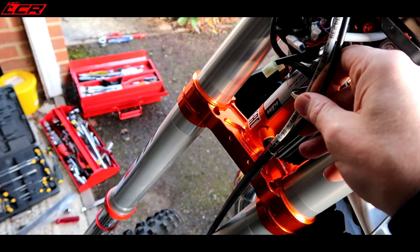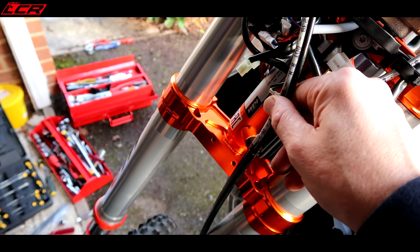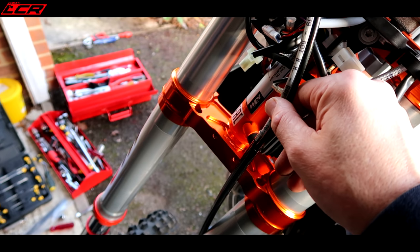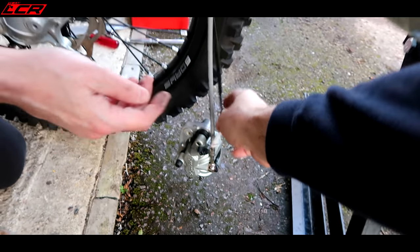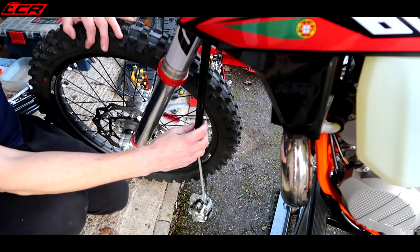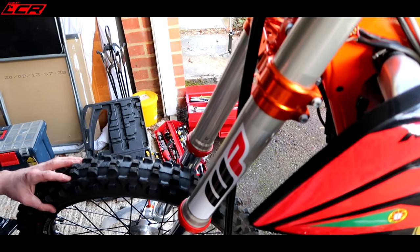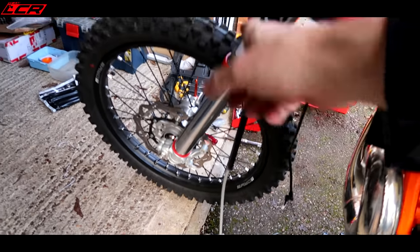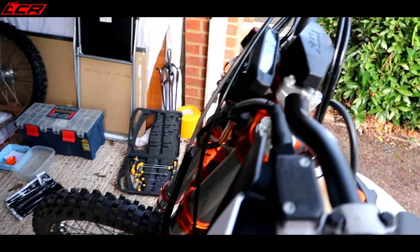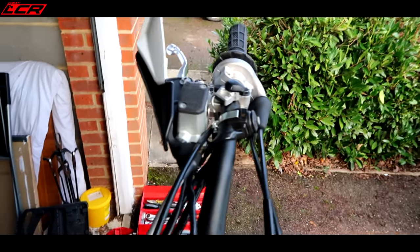That's the speedo — it pulls through the sleeve. It's a pain in the ass — it just about fits through the sleeve hole. Only one end will go through and you reuse the sleeve with the new brake, yes. What we need to do is get it all off the bike first and then deal with that once it's off. For reference, we just pulled that speedo cable through the tube — if you plan to do this, it's tight as hell, but it did go. Right, let's just take this whole lot off then and get it off the bike.